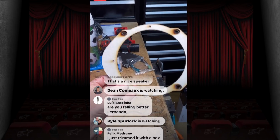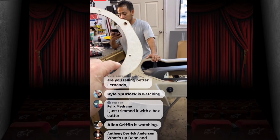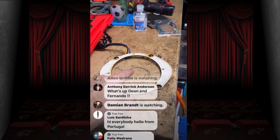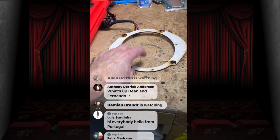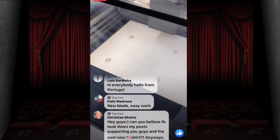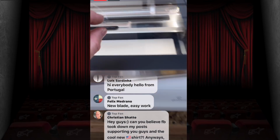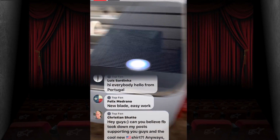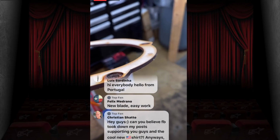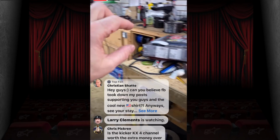What I was going to show you guys, the last one of these we did was the video they're watching right now, the 911. So these are the Hertz Milli Legends. This is an adapter for the Milli Legends that we'd made. And the cool thing is, all we had to do was change the circumference on this to make it a tad bit bigger, like 0.1 bigger, to fit the Focals. And then, of course, over here she's cooking away. She already did our countersunk screw holes, so those are going to sink down so that when we put the screws back into the factory locations, it will be flat onto here. As you can see from this one, it sits a little bit lower and that one's nice and flush. This is even deeper. It's twice as deep on the 1/4 inch, so it goes down 1/8 of an inch, which makes it easy to clear the head of the speaker.